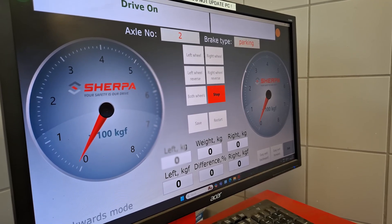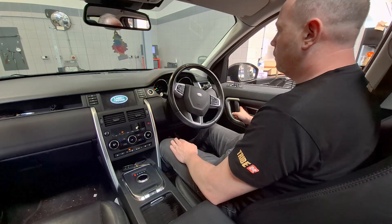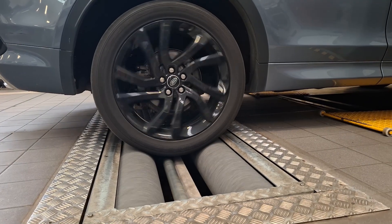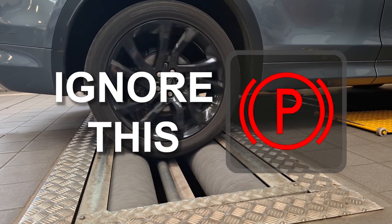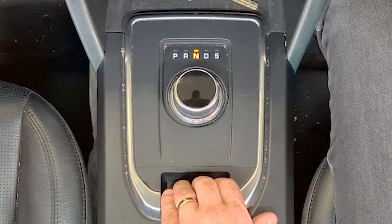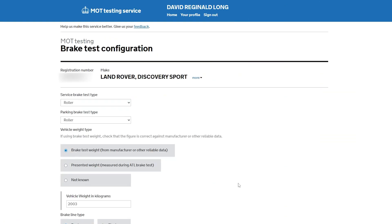Once in manual mode, pop the rear wheels in the roller. Make sure the doors are shut and you don't have the seat belt on. With the engine running and the park brake off, put the vehicle into neutral. Run the rollers and wait three seconds. A little yellow warning light might pop up on the dash — don't panic, it's meant to do that. You might also get an electronic park brake warning too, but don't worry, that's normal. Apply the park brake via the switch for one second, record the readings, and that's it. Then enter the results into the MTS system — it's a bit different, so I'll show you how to do that a bit later.